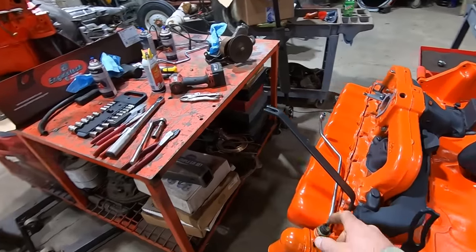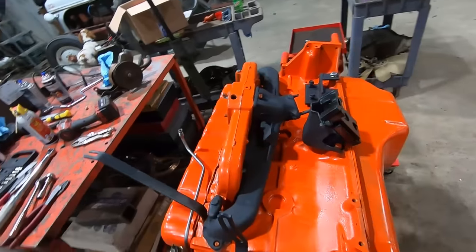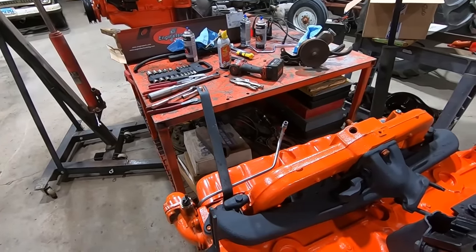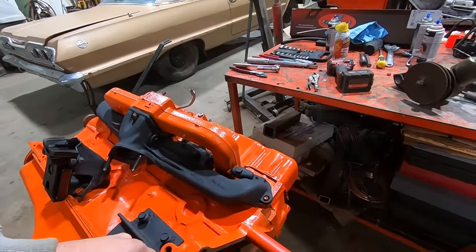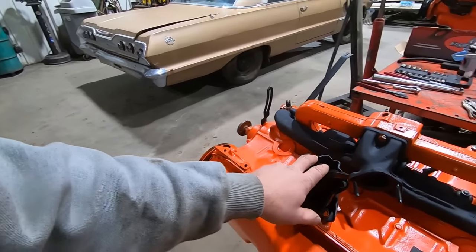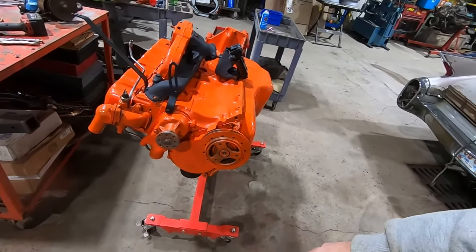We got her all cleaned up, got her sensors cleaned up. We sandblasted the manifolds, or the exhaust manifold, painted that black. I don't know, that paint's probably not gonna hold up. It's not really high temp paint, but it's what we had. Got new frost plugs in it, all the good stuff. So the engines, yeah, new engine mounts. We put a new water pump gasket and new thermostat gaskets.